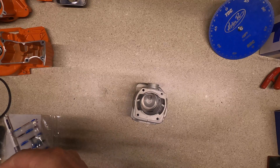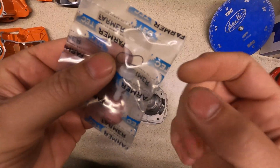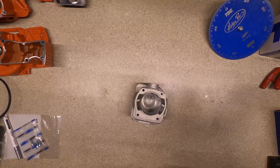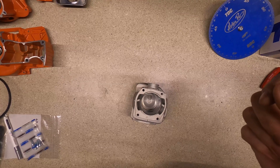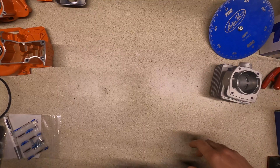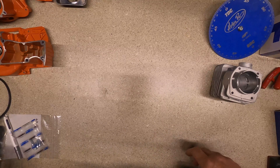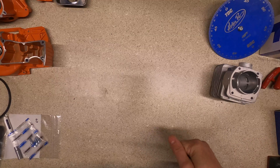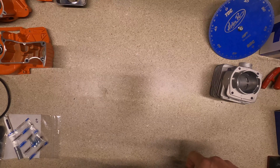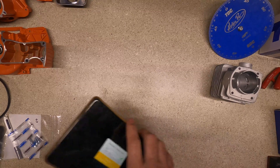I did notice — I don't know if I mentioned it in the other video — there's a little tiny O-ring that goes in behind the oil pump bushing on the shaft, between where it rides against the bearing inner ring. A lot of videos say it doesn't come with the kit, but this kit did. I want to measure it and see if it's something replaceable or if you have to get the OEM from Husqvarna. It's a really tiny O-ring and I'm not sure where you'd be able to buy something like that. But for now, that's it — thanks for watching.